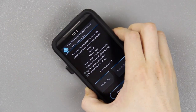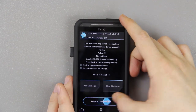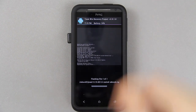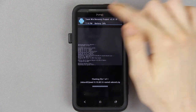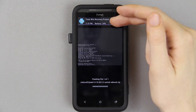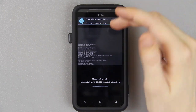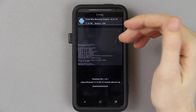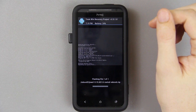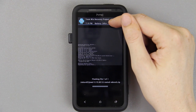And it's frozen. If it's ever frozen on you, just hold it. Okay — swipe to confirm flash. We're good. This can take a while. With TWRP Recovery it's charging my battery right now — you don't see a light because you don't when you're in recovery, but it does charge your battery. Now it shows a plus next to it which means it is in fact charging.